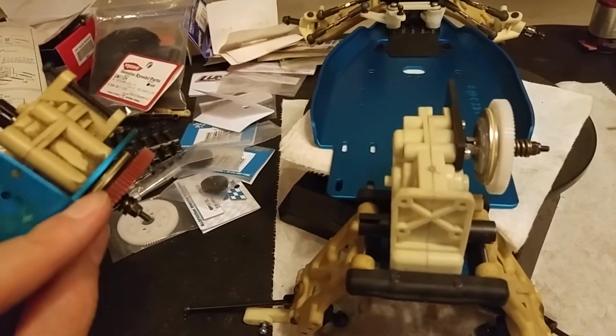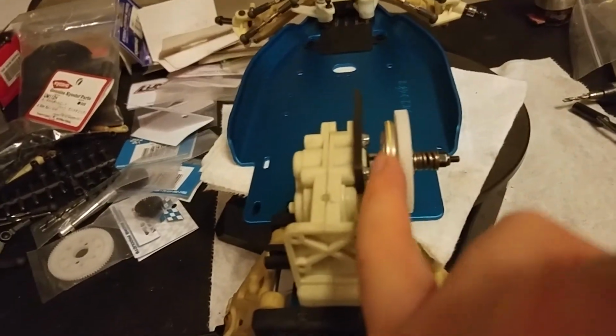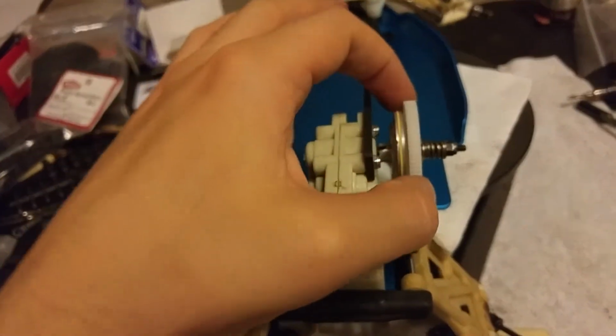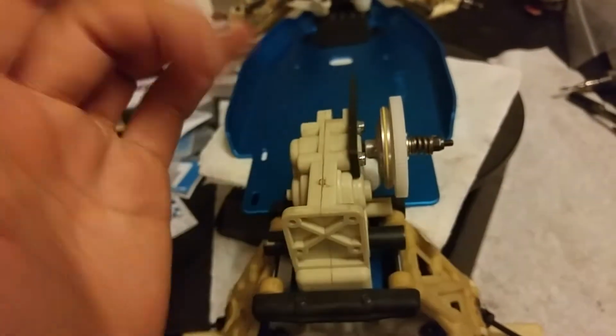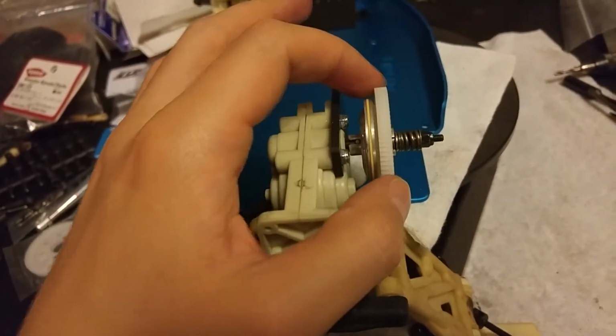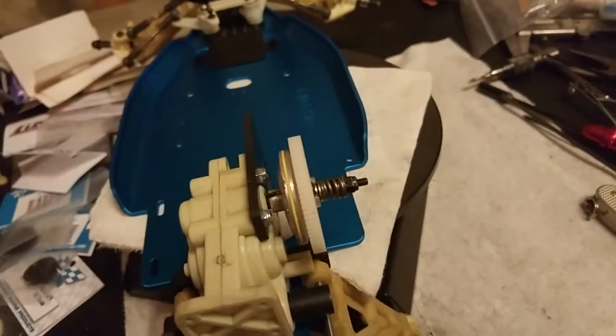But because this part I think is made of steel, I just put this all back together. And this part here, this hub, is made of aluminum. It's lighter weight. I wanted to see if I could keep the aluminum parts on here to minimize rotating mass. So it was a fair amount of Dremeling work. If I had a proper machine shop, I might have done a cleaner job. You can see it's a little scarred back here, but that's okay. Everything works fine. It runs freely.